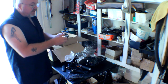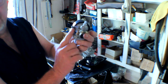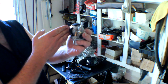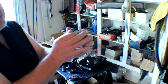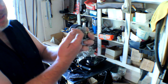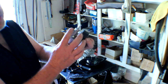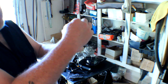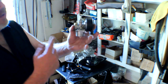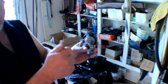Here is the carburetor. With these kits you'll get two different types of carburetors. This carburetor here has your choke lever on the side — you lift it up, and that brings the slide over the intake and forces the carburetor to suck more gas in. So when you start it, you'll lift the choke up, get it running a little bit, and then immediately bring it down and cruise on down the road. This is your mount, which will mount onto the intake port. Here is where your throttle cable will go in, and there's your idle adjustment. You've also got a primer bulb here. There's another style carburetor that has a second cable that comes out where your choke lever is on your handlebar.